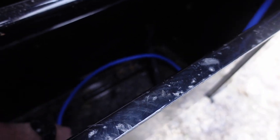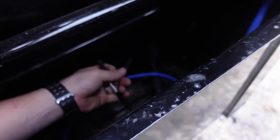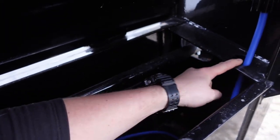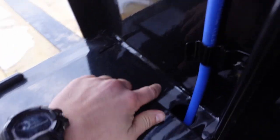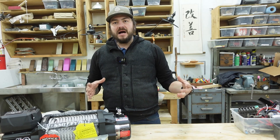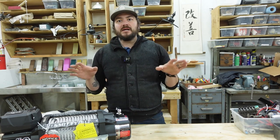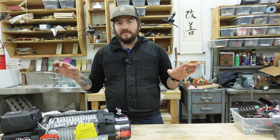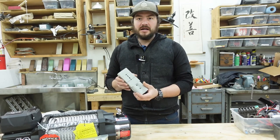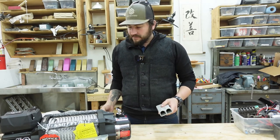They included a battery tray with clips and hold-downs, plus cables — one comes from the trailer power. We'll bring the heavy-duty winch cables into the box and have a connector so we only plug the winch in when we want to use it. I don't want it connected during normal operation — no parasitic drain whatsoever.